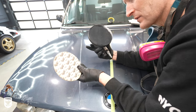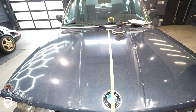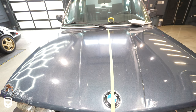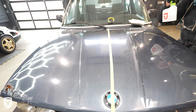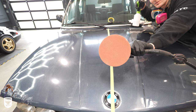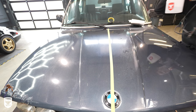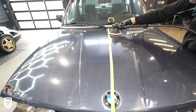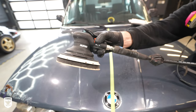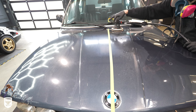I love chatting with the super nerds. I'll take my compressed air and plug it in. I take that off the paint, then I have a little bit of water — just a little splash. You can see the pad is relatively clean. When I'm done with it, you're going to see it's a little bit white. Then I'll clean the pad with water. I don't really use air unless it's dry sanding. The trigger for the air is on this side where my thumb is — it's very sensitive — and you want a little bit of rotation going.